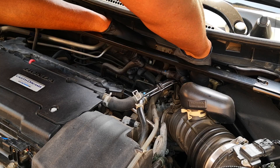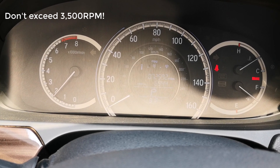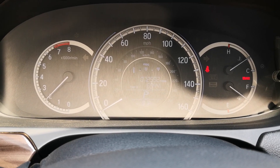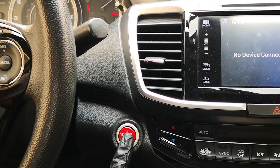I'm connecting the brake booster line, I've lowered the RPM, and then I'm just going to rev it three times — one, two, three. I'll allow it to idle for one minute. That's now up to a minute, so I'll just shut this off and allow it to heat soak for one hour.